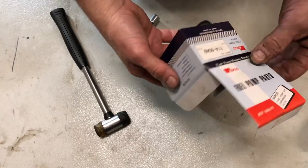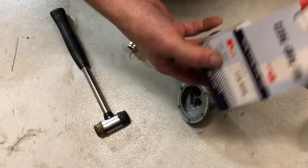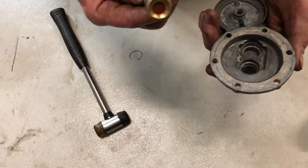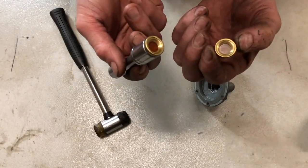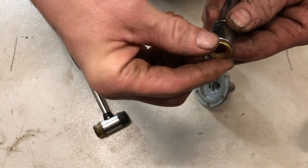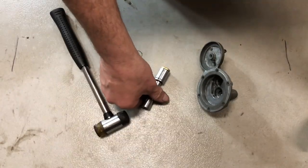Let's put this thing back together. Here's the part number — it's a NAPCO 11A-9349, that's the fuel pump repair kit or rebuild kit. First, I'm going to stick these valves back in. It comes with two valves. This is a 14 millimeter socket. This valve fits perfectly in there with a little bit of tension, just enough to hold it in there.